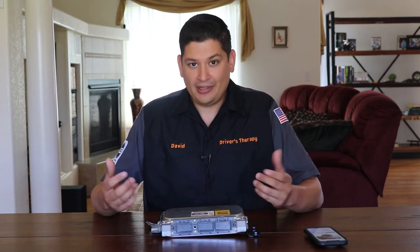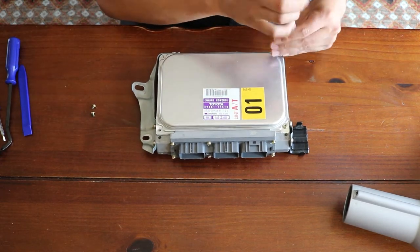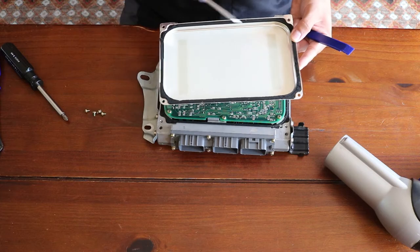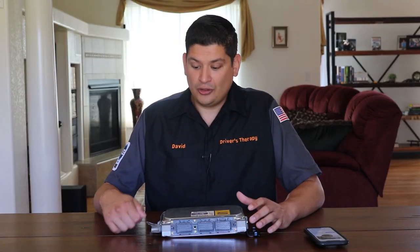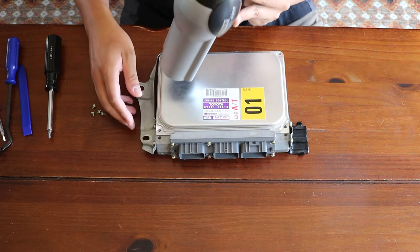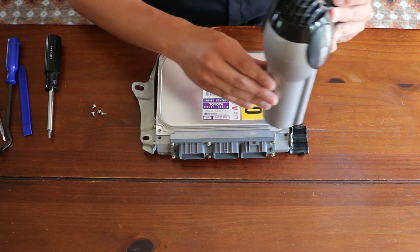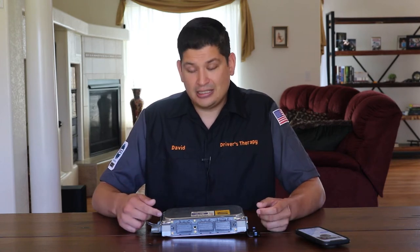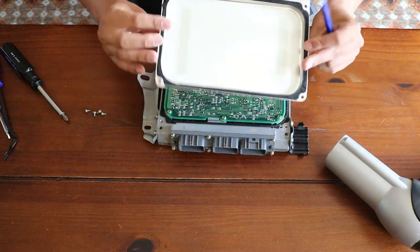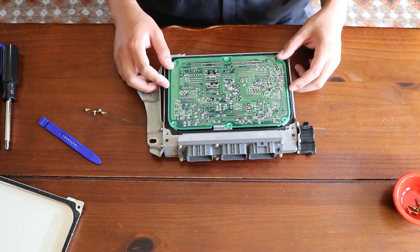I didn't do much research at first — I just wanted to open it up and check for a bad capacitor. There are screws on top, and I removed them thinking the top cover would come right off. It didn't move because there's a plastic rubbery seal that has been baked on. Trying to pry it with a flathead will just bend the aluminum top. The tip is to use a blow dryer or heat gun around the edge — heat up the area to loosen that adhesive seal, then you can pry it up with a screwdriver much easier.